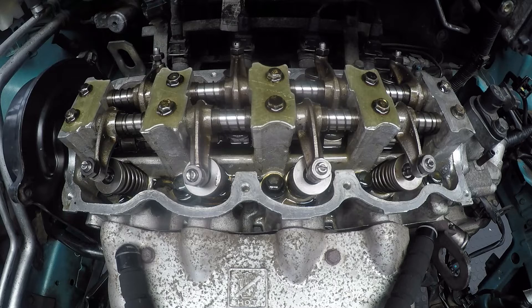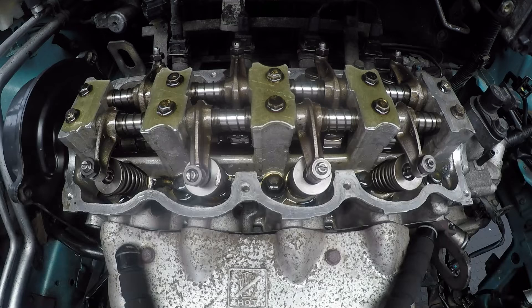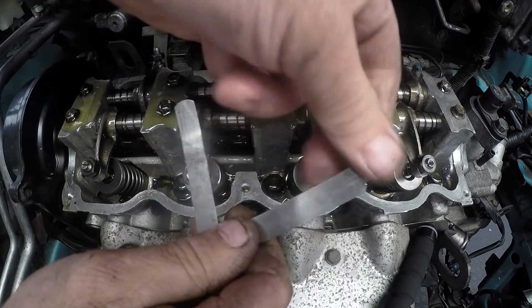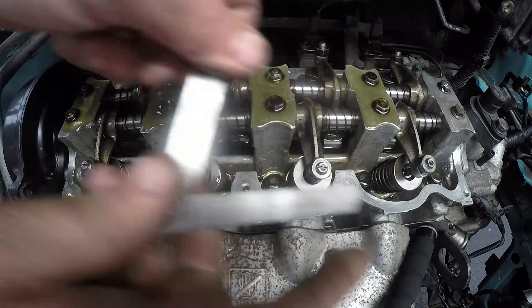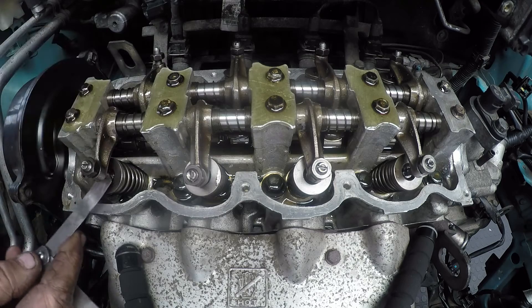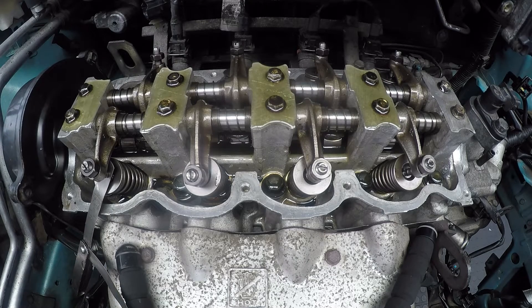The valve clearance on this car is actually a hot setting, so we are at a disadvantage where we need to set it twice. We have to give it clearance now. The intake valve is expected at 0.20 of a millimeter and the exhaust valve is expected at 0.30 of a millimeter. So it's 20 and 30. With the feeler gauge you can feel it's pretty flexible on the 0.20 and a bit more taut on the exhaust. The exhaust valve normally takes the greatest clearance.